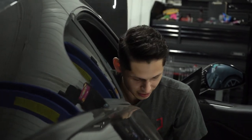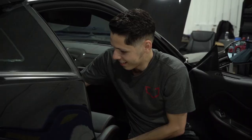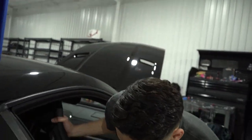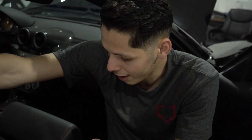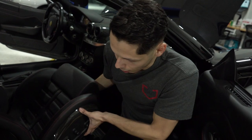Very slow... three hours later. Dude, all I did was touch the seat and look at this — you're still sticky? Yes, it's so annoying. Real genuine Ferrari stick — it comes free with the car. A little more complicated because you can't just take the 17 out here; they hide it right behind the carbon. An easy way is to flip the seat back — there's two T20s, you pop those out and you can get to the 17 to take the seat belt off. The other side doesn't have it because they make that seat go higher and more forward for the driver.